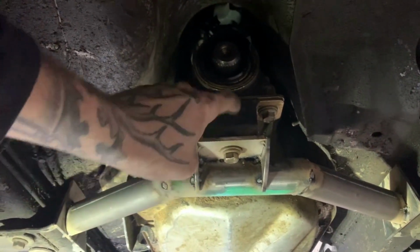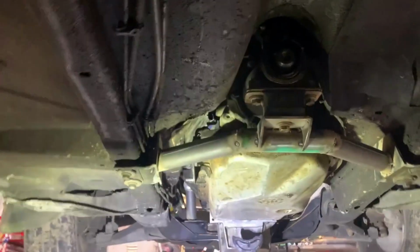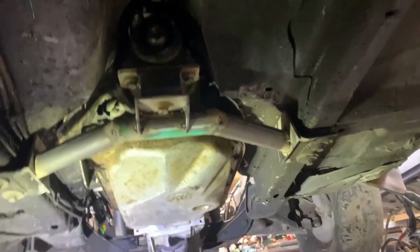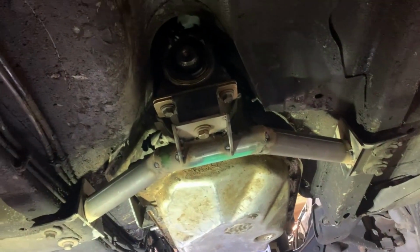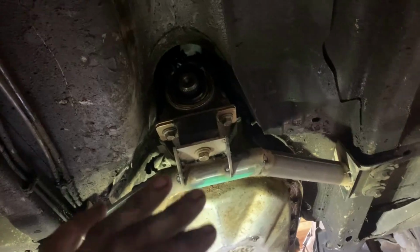And I went ahead and made a little pedestal, bolted it to it. And I made these little pieces here, some gussets to help hold it. And put some tacks on it, let some pressure off, made sure if I need to put some more tacks in places. So I've got it pretty solidly tacked on here. It should not move. I don't want to finish weld it yet. I want to get the turbo kit and everything else in here and make sure everything's going to be golden.